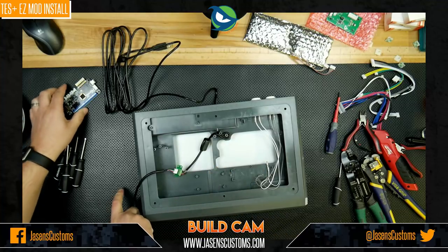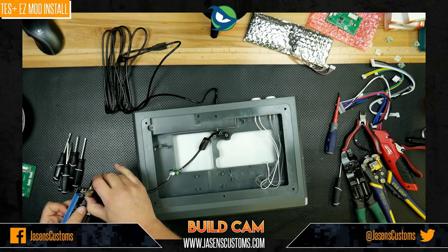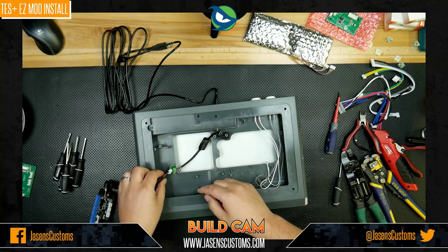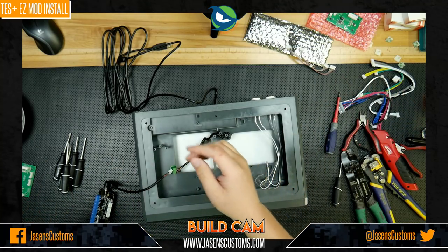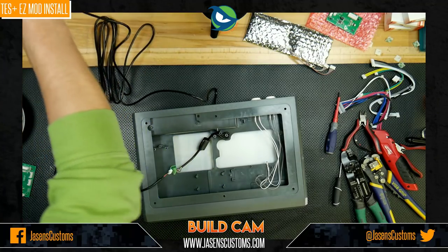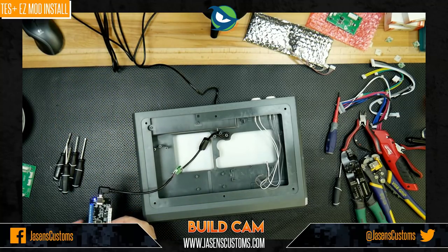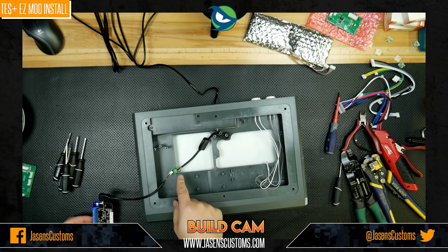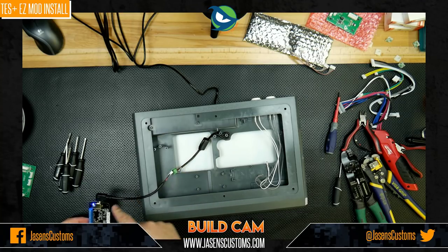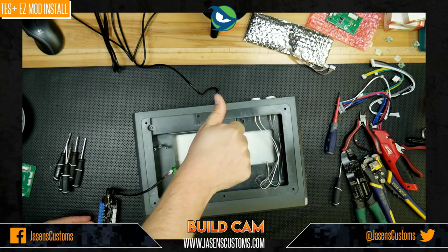So I got that wire out, and we're just going to plug in. This is a good opportunity to make sure that everything's connected right so far and that you've got continuity. Because what you don't want to do is get this all in place and then find out you have to take the whole thing open because you're not getting it to pop up on your computer. So I'm going to reach over and plug this into a USB port. Hopefully my computer doesn't have any fits. The blue light on the Brook board pops on. That's good. And Windows says they're setting up a controller. So that is good. We know we have a good connection between our little adapter board and the Brook board. So boom, there you go. Now you guys can see it. Thumbs up like that. All right, cool.